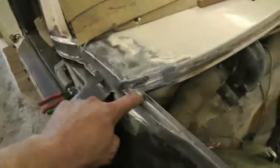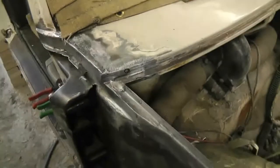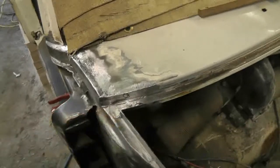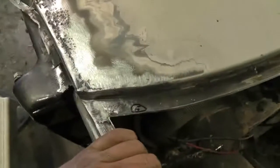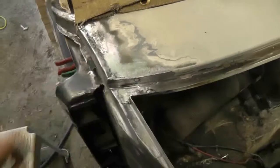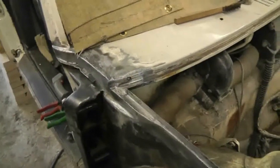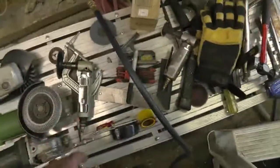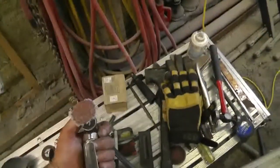Patch 5 is in, all cleaned up. I blended that edge where it overlapped with that piece in with the weld and then ground it down a bit — probably a little bit too much, but I think it's okay. It still feels pretty damn solid. Not the neatest job inside the channel, but I don't have any tools small enough in there.